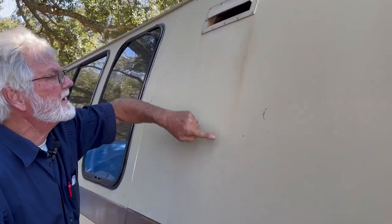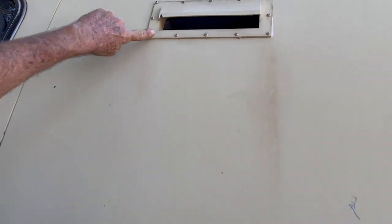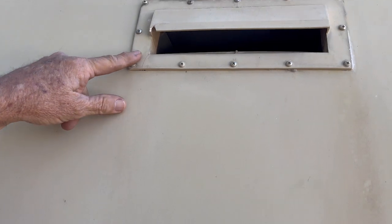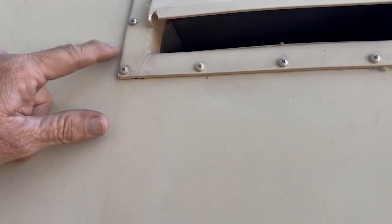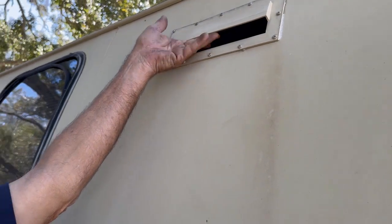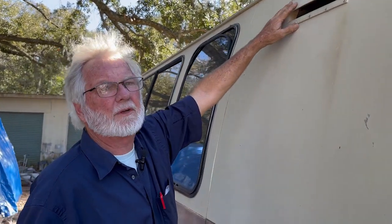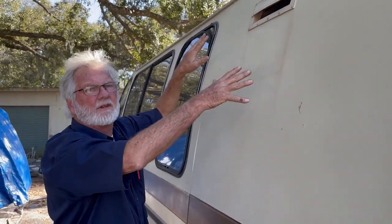But look, you can see the water trail on this vent cover, and right here it's cracked. This crack here — water goes there, it'll go right in that crack. By the way, this is the original one. The original hinge for the little plastic panel that's up in there as a flapper was a piece of duct tape. Don't be surprised if you don't have that. Get another vent — they've got several different kinds. Water got in here and wiped out the kitchen wall in the back.